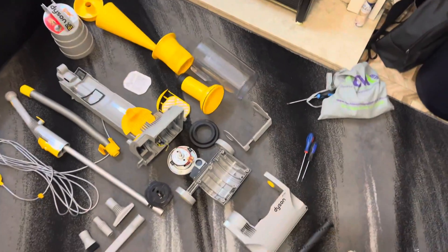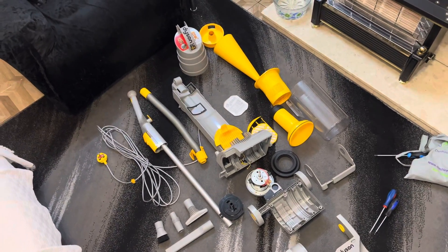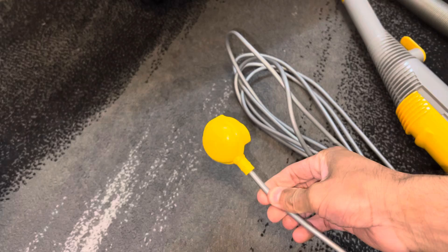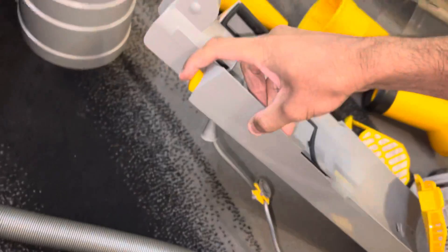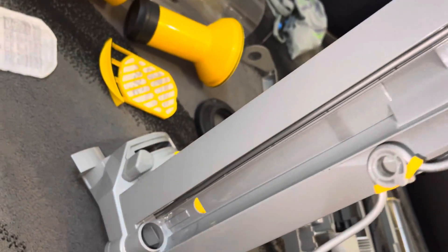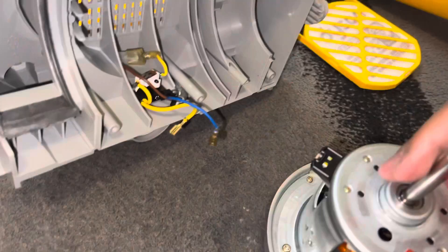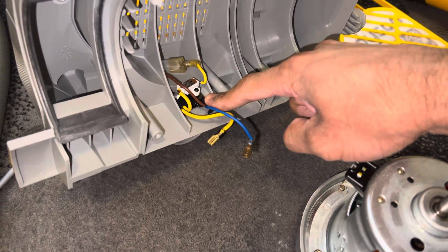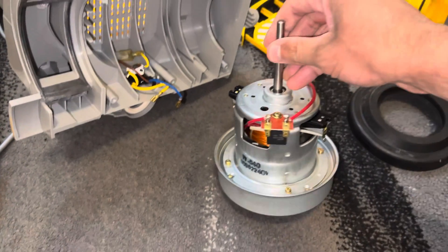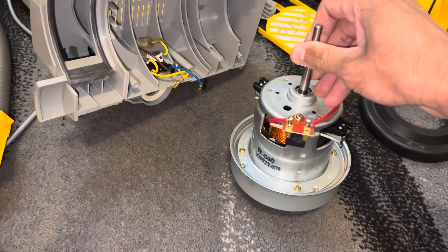Here's the DC01 all stripped down — not fully, but just enough to show you how it works. Mains input comes through this cable directly to the switch. The spinal cord goes all the way down to the motor housing with two wires connecting directly to the YV motor. That right there is the thermal overload cutout — so when the motor overheats it prevents the vacuum motor from turning on until it cools down again, for about half an hour to an hour.